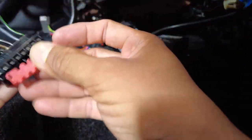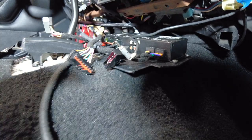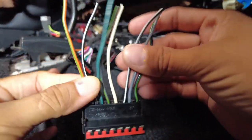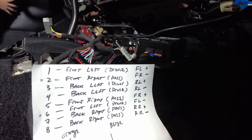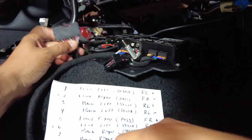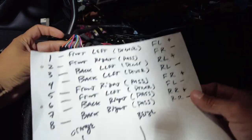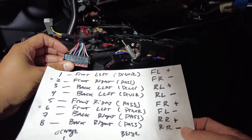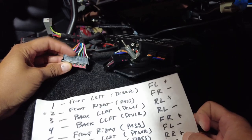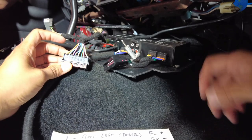Then you're going to go ahead, reassemble your whole thing, and don't forget to put your shield on. Just like that, you have re-pinned your wires, and now your wires should match the correct orientation. The aftermarket orientation is the correct orientation. Now is when you want to freeze your screen — freeze right there because that's the coloring. This is the correct firing sequence and where the speakers go. My pin number two and pin number six were switched around — if you switch them around, these are the correct colors and how they should be going.